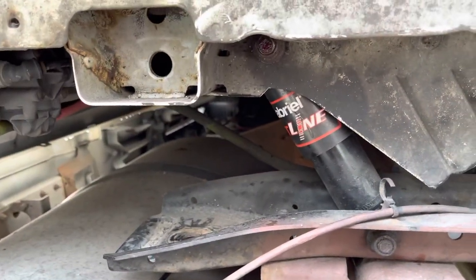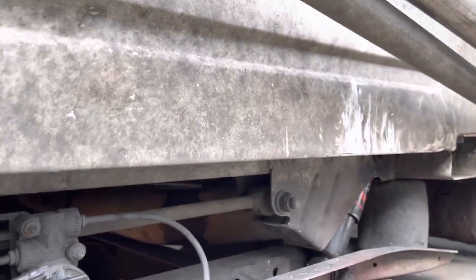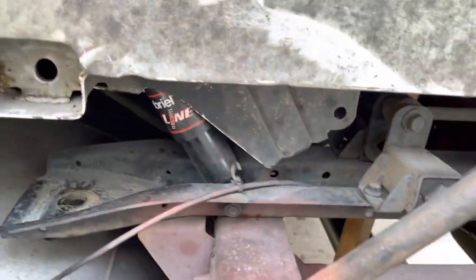It's actually shifted about half an inch to the right, and that's what made that airbag get damaged. I was bobtailing and hit a big bump on a turn — it just yanked to the right and ripped the airbag out. That's how you do it: you need to jack the cab up and it's easy to install it.